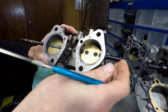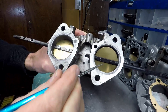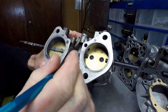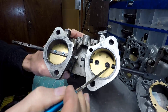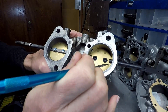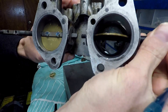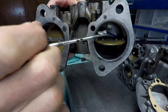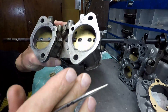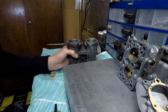There are other things you could do. If you have specialist welding equipment, you can take the shaft off and plug-weld the two holes for the screws, then weld the throttle plate directly to the shaft. That way, the only restriction in the barrel would be the throttle plate itself. That's quite advanced and I don't think it's necessary on this particular unit.